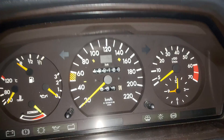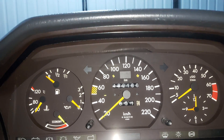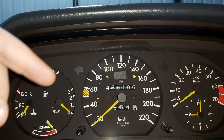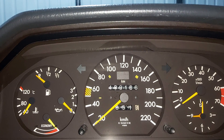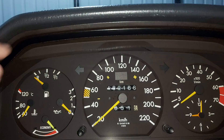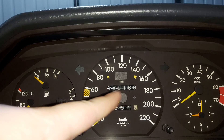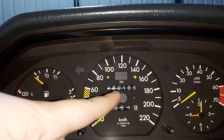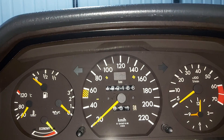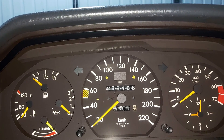The thing I wanted to tell you is that there are many, many of these central clocks that go bad, and when they do you will have to remove the whole instrument cluster and then remove this central clock because your mileage is going to cease showing you how many miles or kilometers you've made.